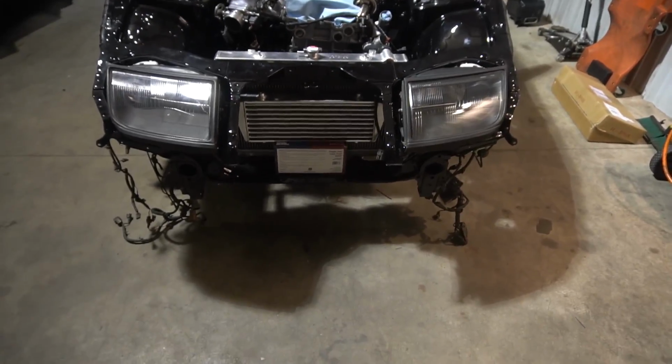When your intercooler is too big, all you're doing is creating a lot of lag for yourself, which you just don't want. When your intercooler is too small, you have a heat soaking problem, which basically means it's not working efficiently enough to cool the air. My SR setup is pretty stock for now, so in the meantime it'll work. A stock SR intercooler is probably about a third of the size, surprisingly, of this little baby intercooler, but it should be fine. Never mind, I got eager and bent some mounts up.